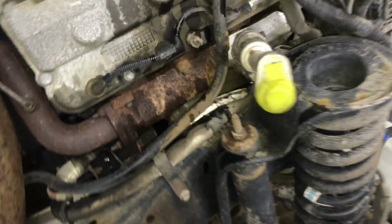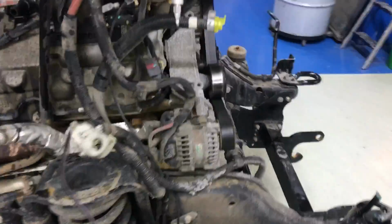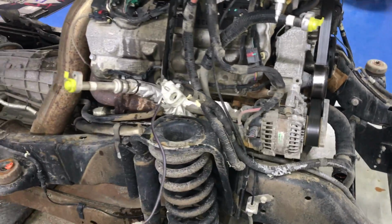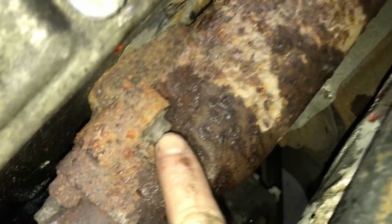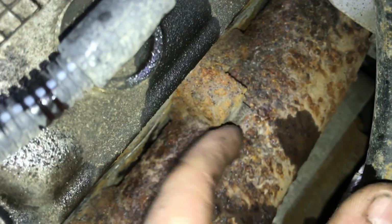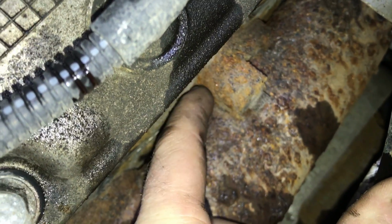I'm also planning on replacing all of the exhaust manifold bolts. Now, that's my plan. I don't think I've talked to you about it, Josh, but that is my plan. I've lifted many cabs because of broken exhaust manifold bolts on 6.4s. So if they're all good right now, it's a damn good time. My opinion on this is, okay, if you look, there's the bolt on the 6.4. That's the same bolt that's on a 6 liter. You see how they incorporated the spacer? You can't even really see it here, but the 6 liter has a little flange right here with a spacer that's probably made out of the same material as the bolt.